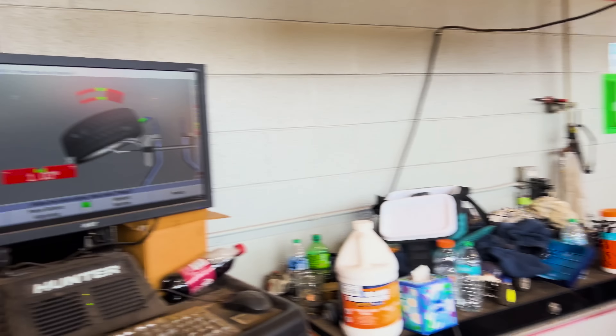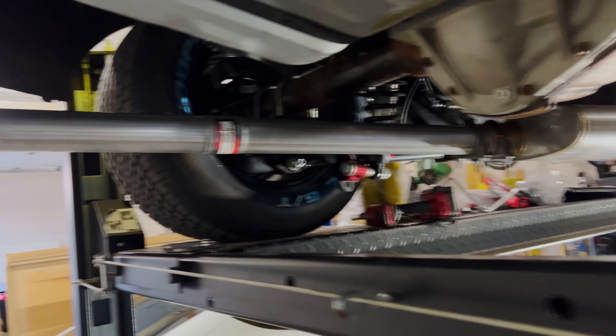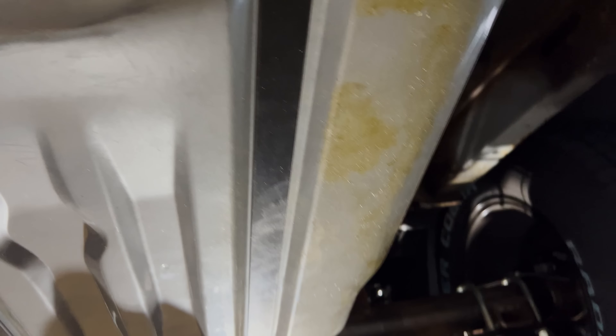It's so neat to see because I do all this with string. They look like vintage race car tires — this is the AutoZone O'Reilly Special, and we have got a hilarious combination of things. I've never worked on an exhaust, especially on this nice of a car with this sh**ty of material. We're clamping from three inch down to two and a half. This is looking good to get the sound and the exhaust out the back of the car.